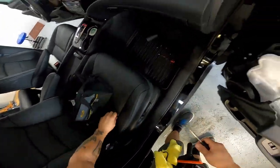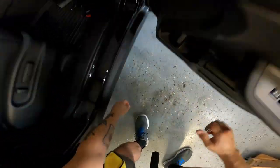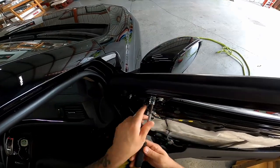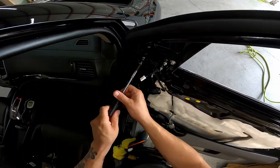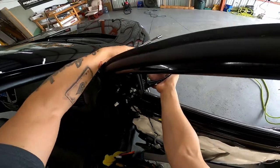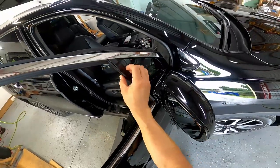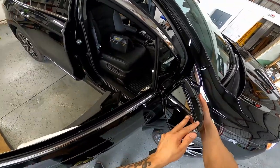From here, you want to take a 10mm. Now these are the three screws that are holding on to the side mirror — we're going to loosen those, because we need to move this pillar and this pin. We don't want to damage this pillar because this rear view mirror is holding up against the pillar. So we're not going to take it off completely, but we are just going to loosen it — just loosen it so that the nut is right before it falls off. Then bring that back. This pillar has to move back, and it looks like it is vinyl wrapped with a little bit of damage already on it. So that's why we loosen up the rear view mirror here.